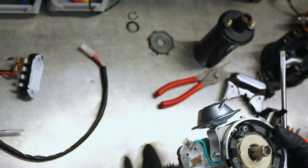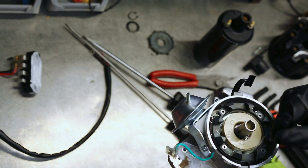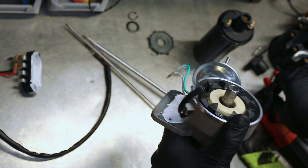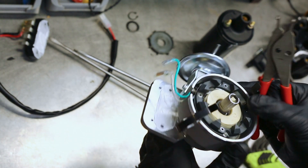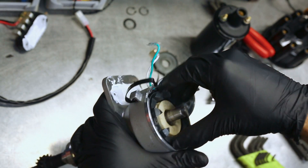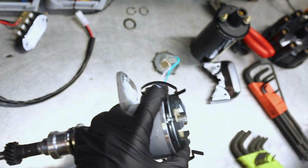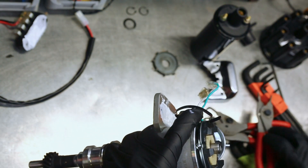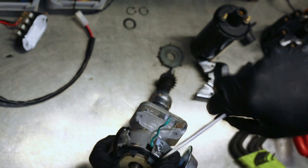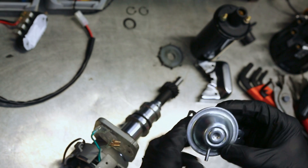There she blows. So what I want to see here is what the advance weights and springs look like underneath. No nasty surprises yet. I've managed to get the rotor off the top — that was a fight. Getting the lower circlip off is a mongrel of a thing, because they don't give you a lot of space to get a set of circlip pliers in. I tried three sets and none of them wanted to work, even the finest ones I've got. I'm going to pull the Vac Advance capsule off. Obviously a brand new unit — hasn't been remanufactured or anything. This whole piece is sold as a brand new unit, so I'm not expecting anything to be second-hand.